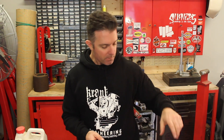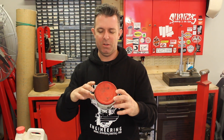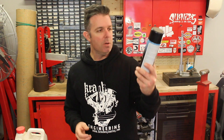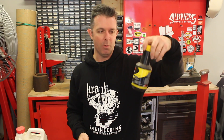You're going to need some sort of grease for axles and bearings. This one is HTB — high-temperature bearing grease — ideal for front wheel bearings on motor vehicles with disc brakes operating at very high temperatures. A standard grease is useful for putting axles back in and lubricating bearings. You'll also need a chain lube, whatever brand works best on your bike. You can use engine oil on the chain, but these dedicated lubes tend to stick more and fling off less.